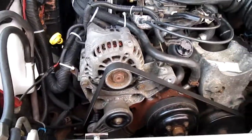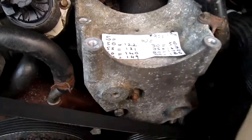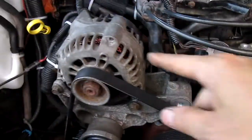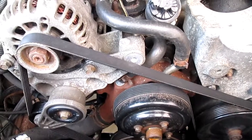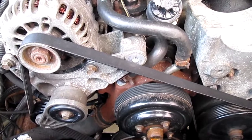If you're not idling a lot you can set it a little higher to save electricity. This doesn't draw too much electricity, and I can see my alternator here spiked up just by not having the clutch fan anymore — so if you ask me if I'm glad I did it, yes.